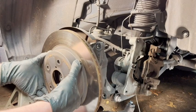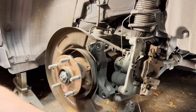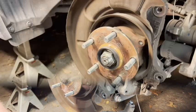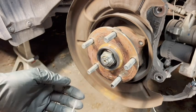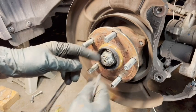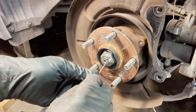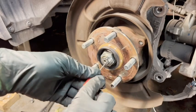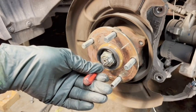Next step, you just lift the brake rotor right off — it just comes right off. Now before I started working on this I did some research, and on some of the older models you actually had a cotter pin through here keeping this nut from turning. Here, for whatever reason — probably to save money — they just indented the nut instead, and it's really hard to get out.